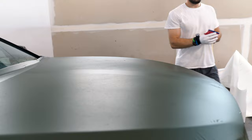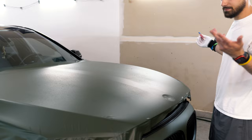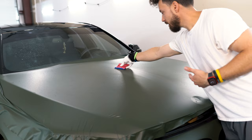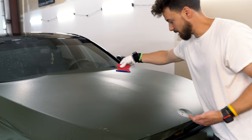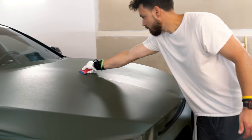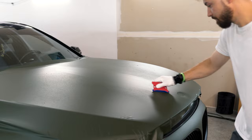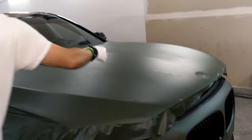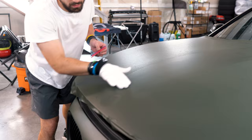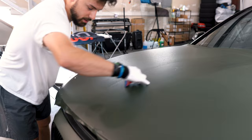This is my starting point. From here I'm going to squeegee either this way or this way — personal preference. I always start in the middle. You always want to hold your squeegee at about a 30-degree angle to the surface you're squeegeeing on, and you want to do strokes that overlap. You don't want to go too far one way or the other — keep it right about here. Tuck it down; you can use your palm, you can use your fingers — that's what the wrap glove is for.